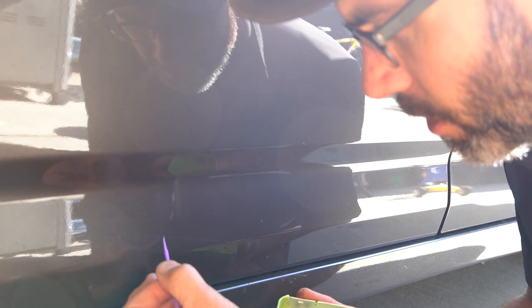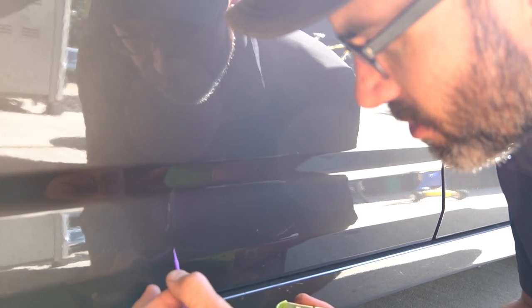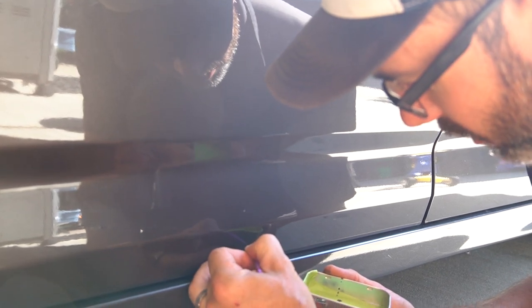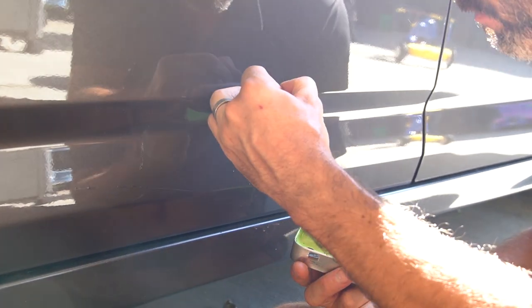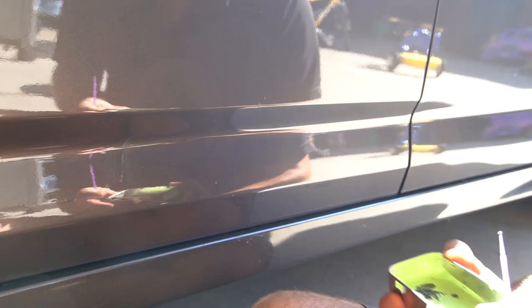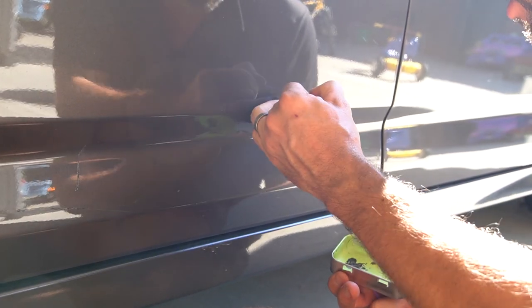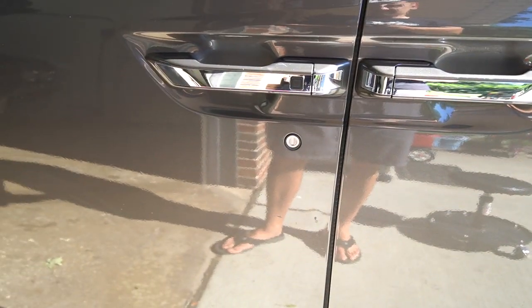Usually, in my shop, when I'm doing full vehicle touch-up, I usually charge $10 a panel just to do the touch-up. And then if I have to integrate sanding services, it usually starts to get into about $50 per panel for a number of reasons. Reason number one, a lot more time, because I can't do it all in one sitting. I have to touch up, let the vehicle sit, so it becomes a two-day job. And it's just a lot of work. There's risk involved, because sometimes you try chasing down a little scratch, a little bevel, and sometimes it happens where I have an accident, have an error, burn stuff.